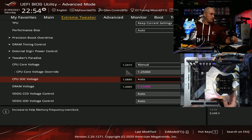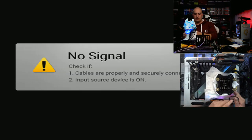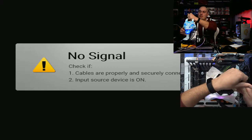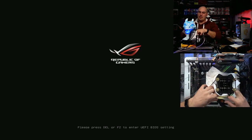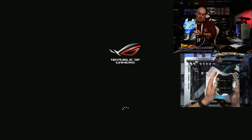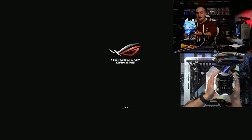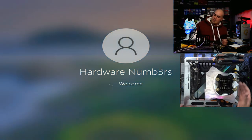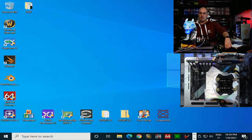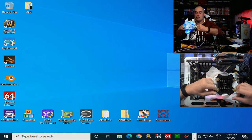So let's boot into Windows. Voltage memory, I think it was like 1.4 and something, 1.5. Now I go back and check it. But it's a profile that I use for daily, so it's a very relaxed profile. For daily, I use like 3800 MHz, 1900 FCLK, but it's a daily profile, so it's stable, it's tested like 20,000% of MemTest, so it's a very stable profile.